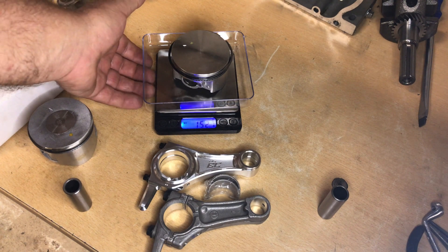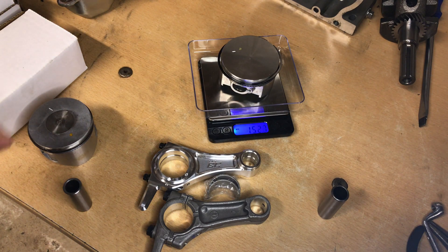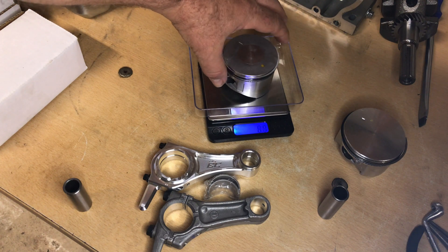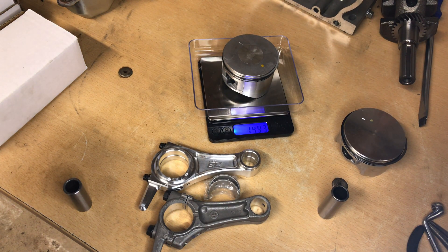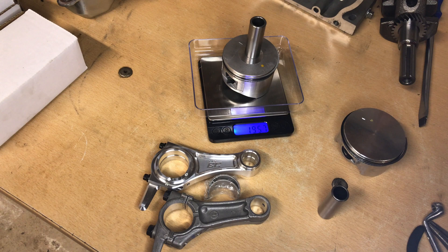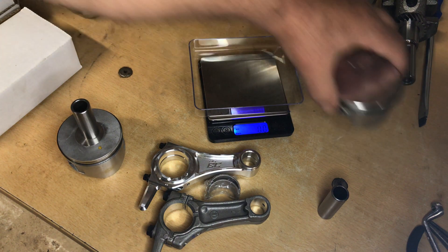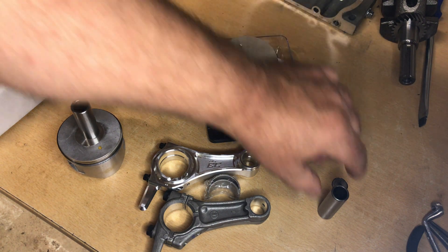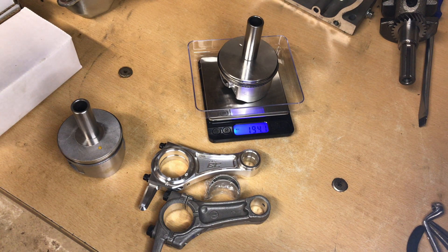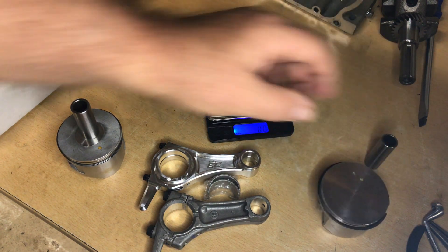That's not much more weight than the LCT piston. Big difference on the bore with not much weight on that piston — and that's another reason I like those Wildcat pistons. Much lighter. The LCT pin and piston combo is 195.7 grams. The Wildcat piston and wrist pin combo weighs 194.1. So that's pretty close — I'm liking this.